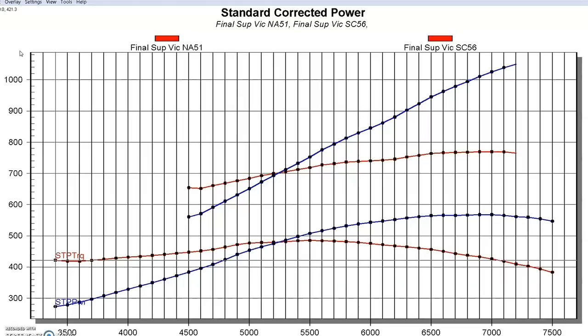The fact that we reached the torque peak at 7,000 RPM shows this thing had a lot left and was still climbing. Even though on our 6-liter we had a fairly mild centrifugal supercharger cam from Brian Tooley Racing, this thing still made a ton of power. It just goes to show you: start with good NA power, add boost, and good things happen. Making 1,000 horsepower seems almost routine, but 1,000 horsepower is a lot of power, and this thing did it without any problem at 15 pounds of boost. Now let's take a look at the air-fuel curves and see if there was a change after we installed the supercharger.